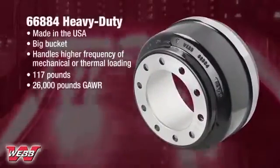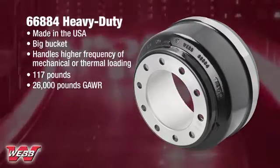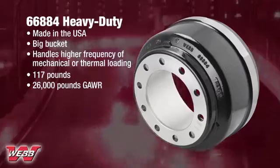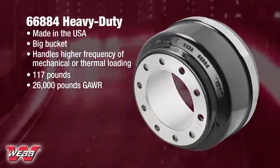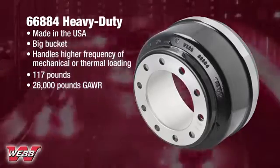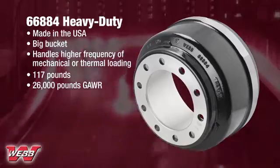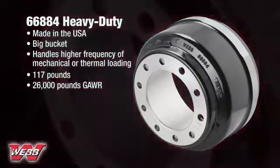If your application is more demanding and you need an even bigger bucket, Webb has you covered with the 117-pound 66884 brake drum. This workhorse is right for you if your application requires a higher frequency of mechanical or thermal loading compared to standard duty applications. It is rated for axles up to a maximum of 26,000 pounds gross axle weight rating.